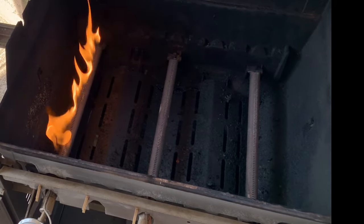I matched my wire colors to the colors on the back of the igniter. Remember, you don't really have to remove the igniter from the control panel — I just did it for better video quality. Put the igniter back through the control panel, tighten down the plastic nut, then set the control panel on the grill — there's basically a hook on each side that it sets on top of. Put the control knobs on; they have a half-moon shape so time them with the control valve and push them on. The battery for the igniter goes opposite of what you'd think — the negative goes on the outside of the push button. I put a new battery in, tightened the push button, put the two screws holding the control panel back in, and tightened those down. Get one last look underneath to make sure the igniter wires look good and nothing got pinched. Then put the bottom cover on and tighten its two screws.